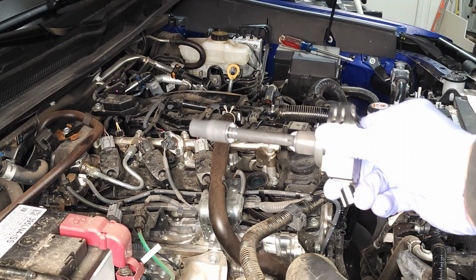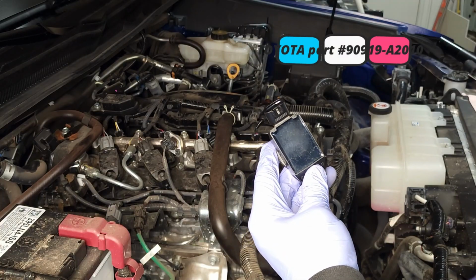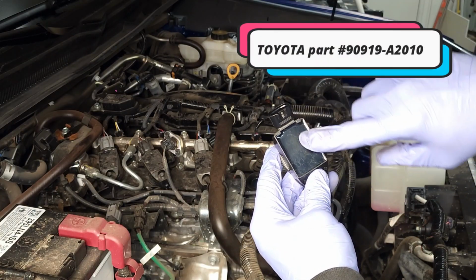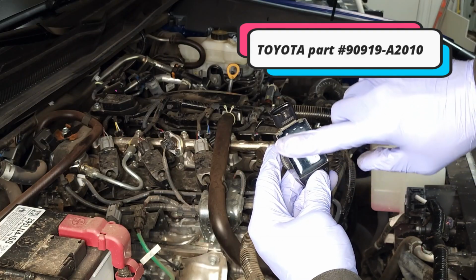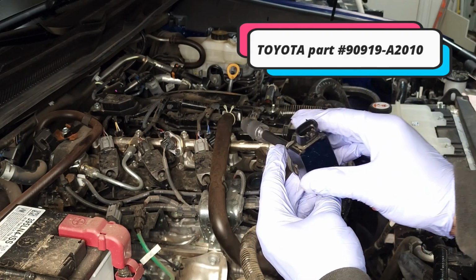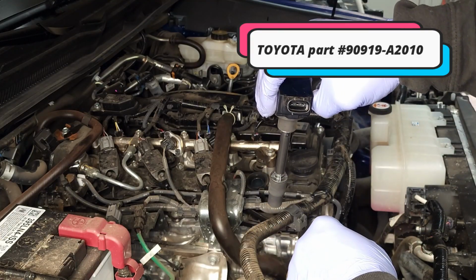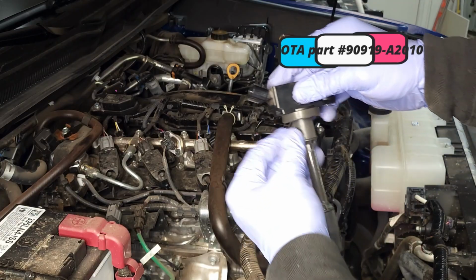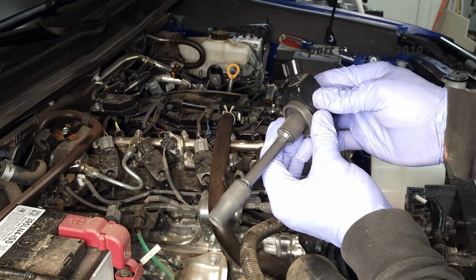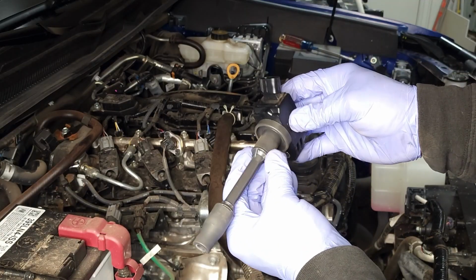That is your coil. Let's go ahead and inspect it from top to bottom. What you have here is a slightly concave top, and this is where the voltage is boosted. If this was slightly swollen, you want to get rid of it. You have your 3 electrical prongs right here. You see they're nice and straight. Moving down, you have your dust cover. Okay, that should be there.